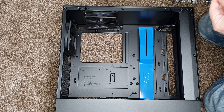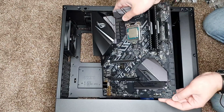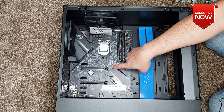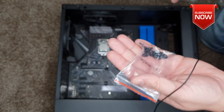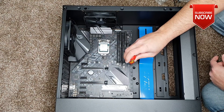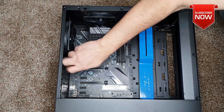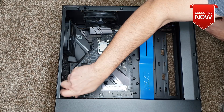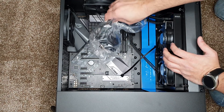Let's get the motherboard installed in the case. With this ROG motherboard you don't need to install a separate I/O shield — everything is pre-built in. Simply place the motherboard inside, make sure everything sits down nicely, and line up the standoff into its hole. Then use the proper screws to fasten it all. Next, install the radiator inside the case and make sure you cover the AIO pump to prevent it hitting the motherboard and causing damage.